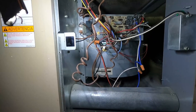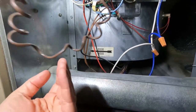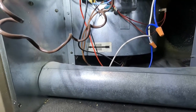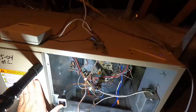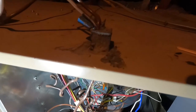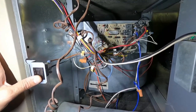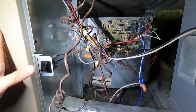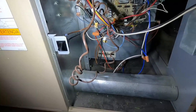So if it's just buzzing like that and nothing's happening — the fan's not spinning — we can reach inside and just give it a little spin, hit the blades. You can also use a little popsicle stick if you don't want to stick your fingers in the fan. Press down the door switch, and you can see the little rotation arrow right here on the blower fan. I'm going to reach in and give this a little flick — there we go. Okay, so that did start this time.